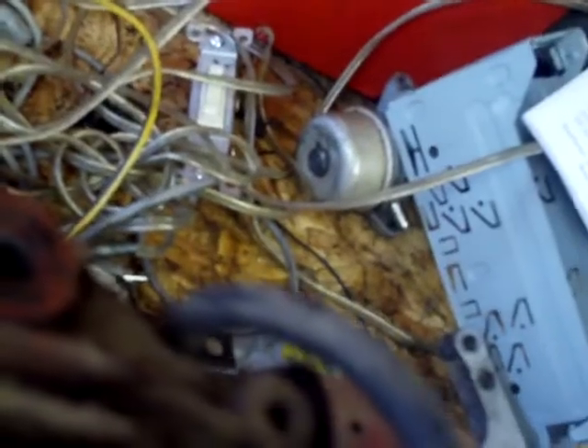A few people have asked me to take the head off and see if it's a stuck valve or what's wrong. It seems like it has a bit of compression but not very much. We're not going to take the bottom end off right now — that will be a separate video, just the top end. Don't lose these little washers. I imagine this thing has never been opened. I got it secondhand and I really don't know its history. I broke the bolts free with a ratchet — didn't use air tools, didn't want to damage it.